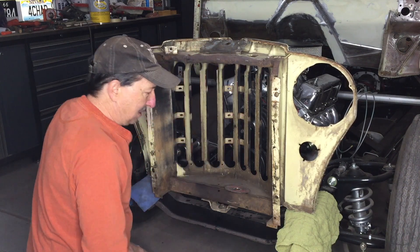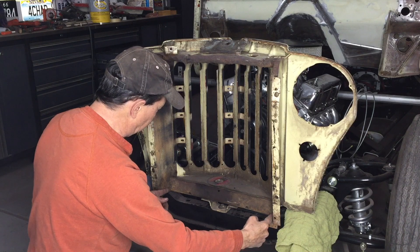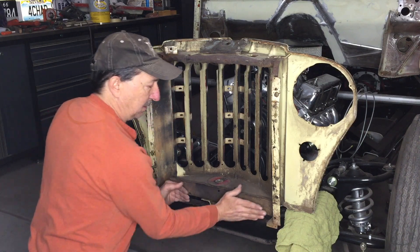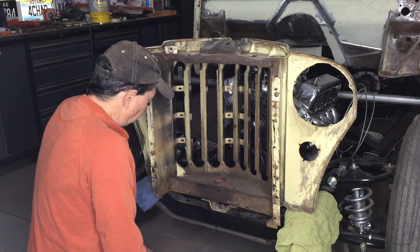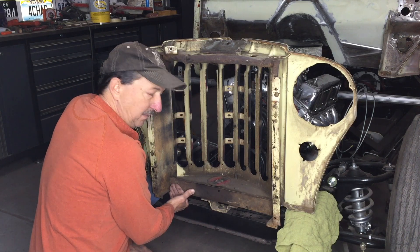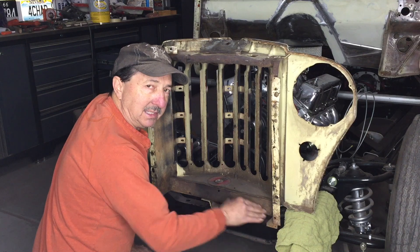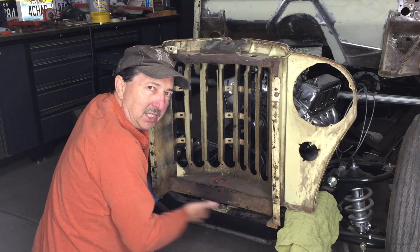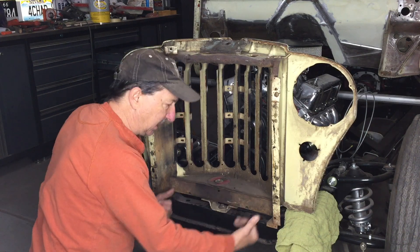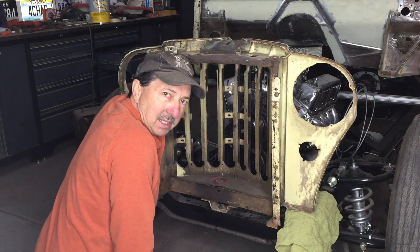Height-wise it's exactly the same too - it's just a perfect fit. Down here at the bottom, what they did is they cut in both sides and then bent it up, so the Pinto radiator they used hung down just a little bit in this area. I'd like to bring this back and restore it the way it was, especially since my new radiator is going to be right at the bottom of this - perfect alignment. It'll tuck away that aluminum finish underneath and hide and protect it. We'll see if I can straighten it out and weld it back up and restore it.